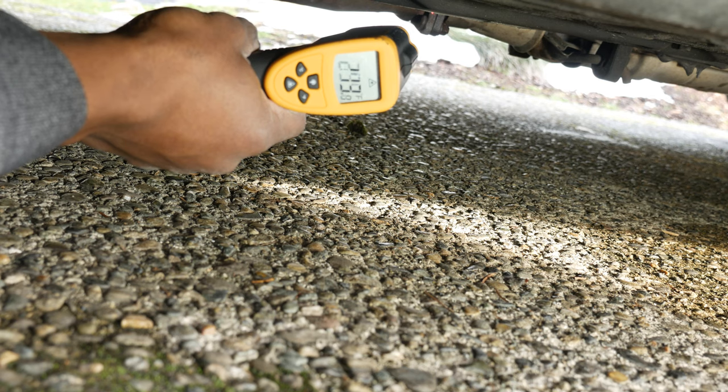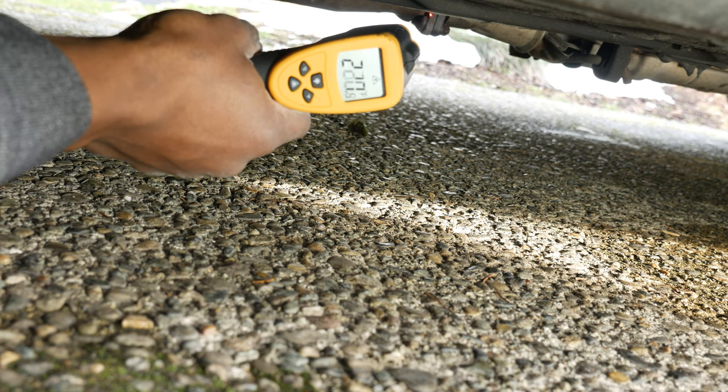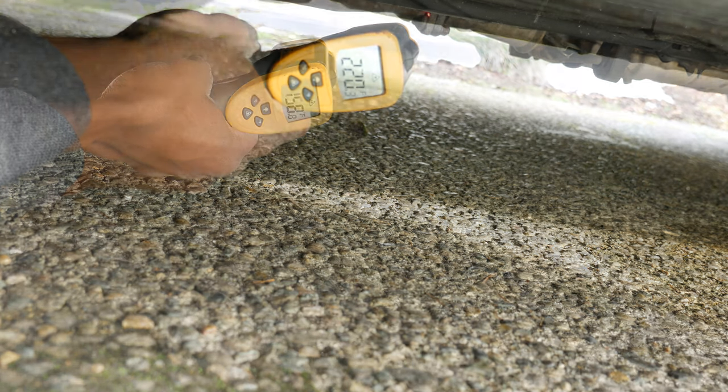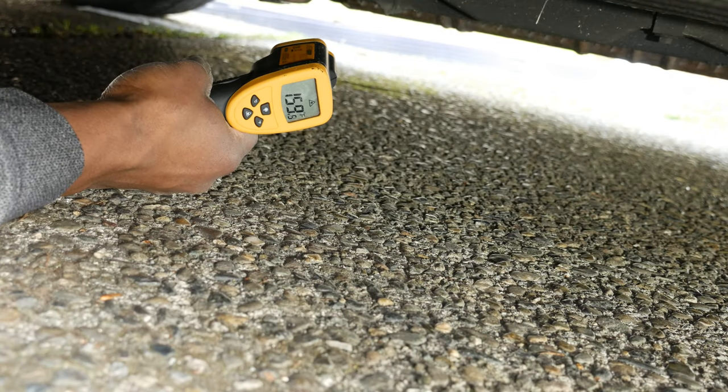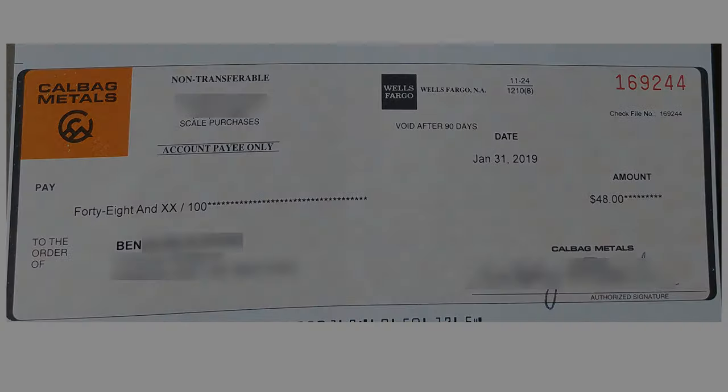Let's take a look at the cat inlet and outlet temperatures. We're currently at around 220 degrees on the outlet side — the original cat's outlet temp was only 115 degrees. The inlet temp is around 160 degrees, so our temps are much more in line with what's considered normal. One last thing: make sure you recycle your used cat since it contains precious metals worth some cash. I received $48 for mine from a local scrap yard, though I probably could have gotten more by shopping around online.